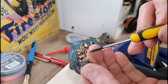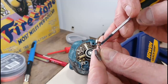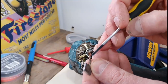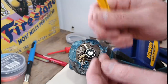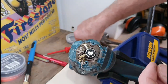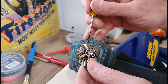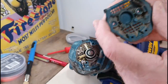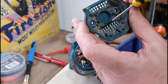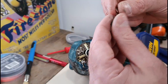I'll pop one out. See how that one just slid out straight away? There is actually plenty of meat left on that. You can see that copper cable wire connecting the little clamp here that clamps onto the side, giving it a contact and a grip — that's the connection. You can see it has had some kind of heating up — it's changed colour. It's even got a blue piece there which has come off the actual drill, so it's been heating up to such an extent that it's touched the back casing.